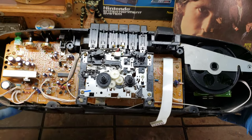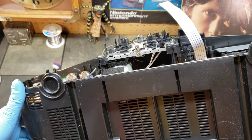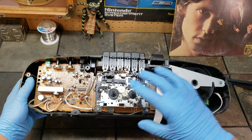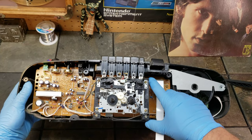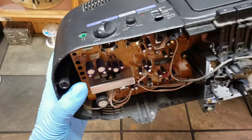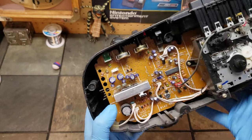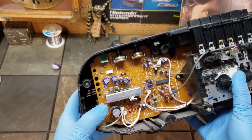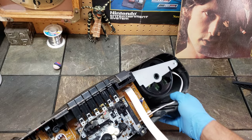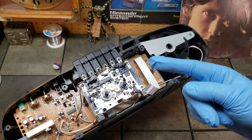This tape deck mechanism looks like it's going to be very easy to work on. I can see the belts — the belts are still there. Maybe they just came off and stretched. It appears this whole mechanism just comes up from about six screws around the perimeter. This right here is the amplifier section — I can tell by the way it is. The chip number is LA4957, which I've actually seen before, probably in another boombox. I'll throw up the datasheet right here.